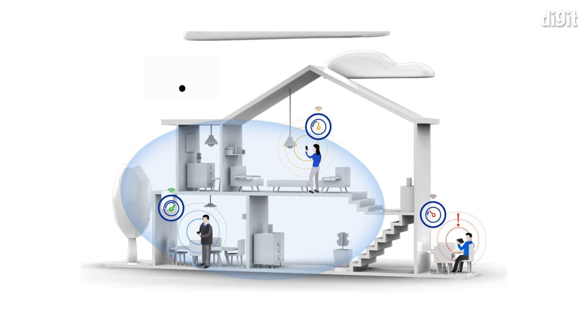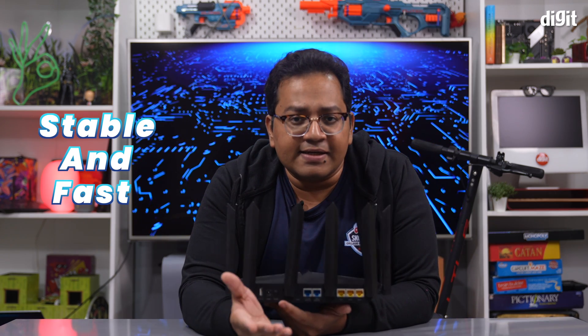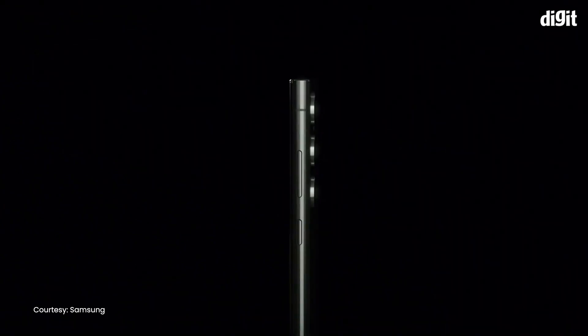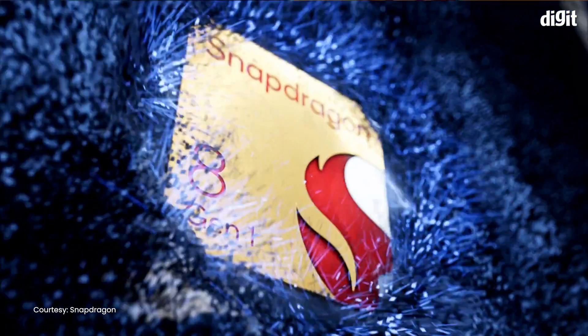However, if you're in an environment with a lot of thick walls, you are going to have difficulties with the 6GHz band. We tested the TP-Link Archer AXE95 in a mid-sized office with multiple walls and obstacles. On the 2.4GHz and 5GHz bands, the router provided stable and fast internet connectivity to all of our devices, including smartphones, laptops, and PCs. We didn't experience any dropouts or buffering issues even when streaming 4K videos or playing online video games. Switching to the 6GHz band was an entirely different story — it was simply not visible to a lot of our devices. We used flagship smartphones such as the Samsung Galaxy S23 Ultra, the Vanilla S23, the Pixel 7, and a few others with the latest Snapdragon 8 Gen 1 SoCs, and none of them could spot the 6GHz band.